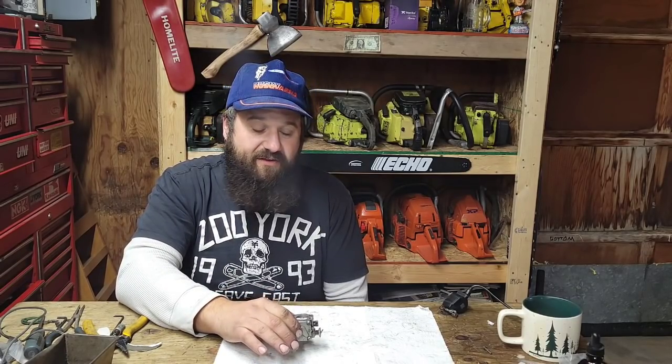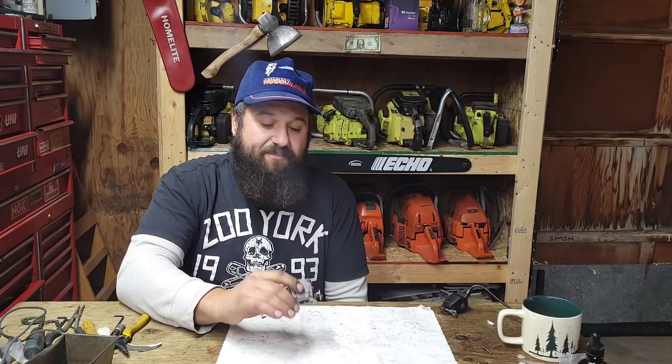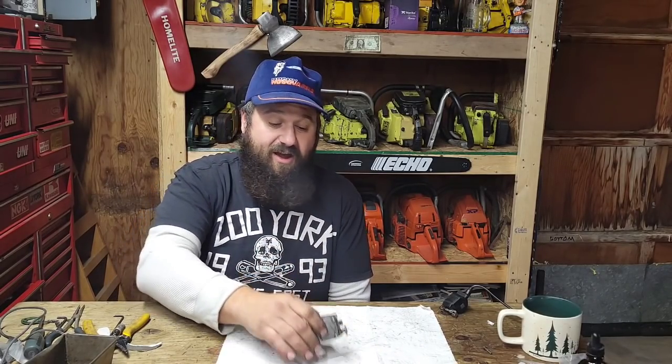And if you keep a low exhaust roof and move lots of air, they're still going to pull good RPM and they're still going to be really hard charging saws. So I think we have a winning package here. I won't know until I run it though. These timing numbers are totally different than what I've run on previous 272s that you've seen on this channel. I've been all over the map trying to find the sweet spot for 272s.